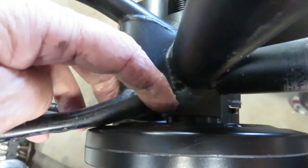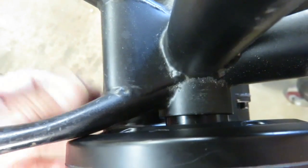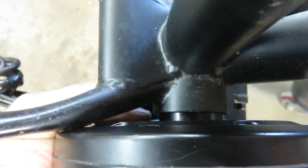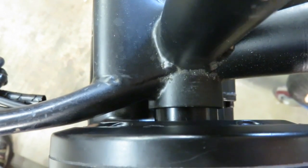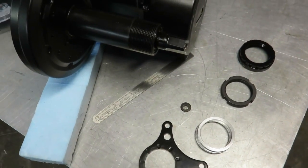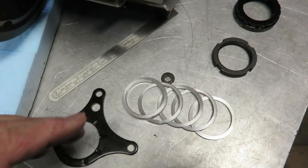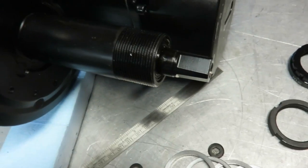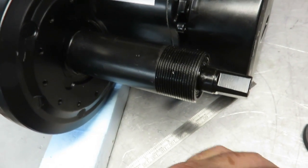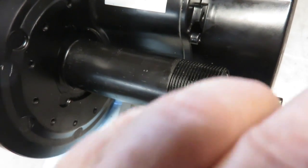So we're going to remove the unit, put shims on the axle — on the BBSHD axle, bottom bracket portion — and shim that so that we have some appropriate clearance. Let's take a look at the shims that come with the unit. Here they are. Here's our bottom bracket portion of the unit, the motor unit. I'm going to slip these on, and because it looked like there was quite a bit of distance between here and the end of the bottom bracket, I'm going to put all of these shims on.